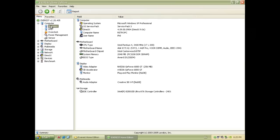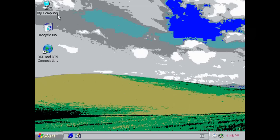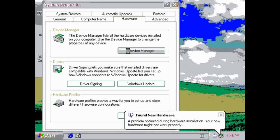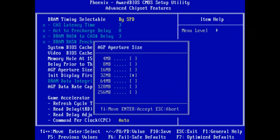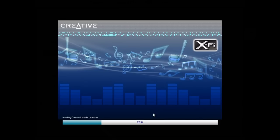Everything is now installed. I did run into two small issues. First, the Nvidia graphics card wouldn't work properly — we had limited resolutions and colors available, and an error telling us that not enough resources are available. It turns out a BIOS setting needed changing; lowering the AGP aperture size fixed the issue. I also ran into issues with the sound card — it turned out to be a Dell OEM version and even the generic drivers wouldn't work, so I just swapped the card.